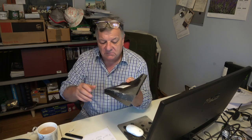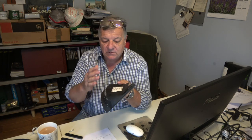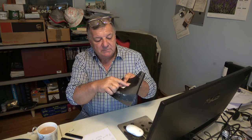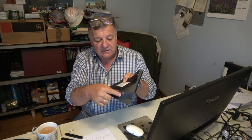The first thing you can see is that this was all taped up, and even the paint has come off, so the transit paint on them is extremely bad. But that's not an issue because it needs to be rubbed down anyway. The biggest issue with these is the profiles are badly stamped. You can maybe see here, and I'll show you this in detail, the stamp in here is particularly poor. It needs a lot of hammer and dolly work to get this right.